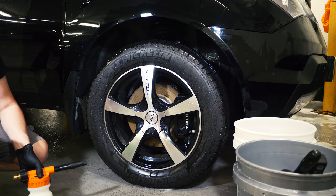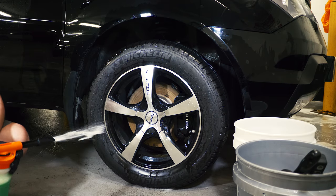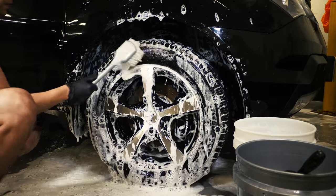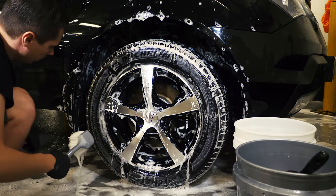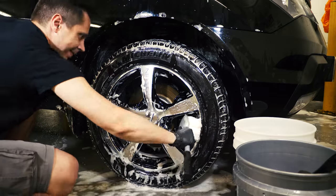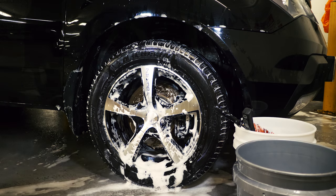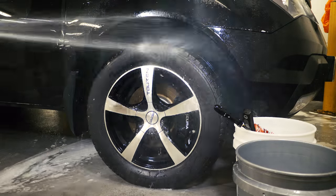Let's move on to the wheels. I do that because I don't want the car to sit wet while I wash the wheels — it's much easier to dry the wheels after. I'll use the same water in the buckets since there wasn't too much contamination on the front — and remember, you would usually start with the wheels, so the water would be clean anyway. First, use the big brush to wash the tire and outside of the rim, and also scrub the wheel wells — you don't want a clean car and clean wheels ruined by dirty wheel wells. Then use the wheel woolly to reach those tight spaces, go behind spokes and in between the wheels and brake calipers. The level of craziness may vary from person to person — if you're really nuts like myself, you really go into it hard. Move on to the next wheel until all wheels are done.